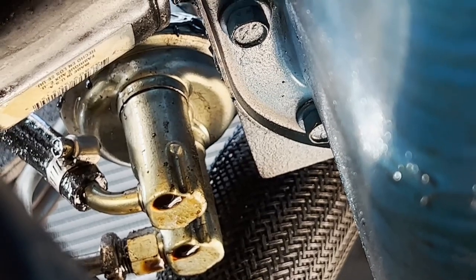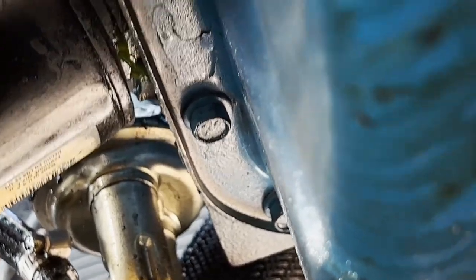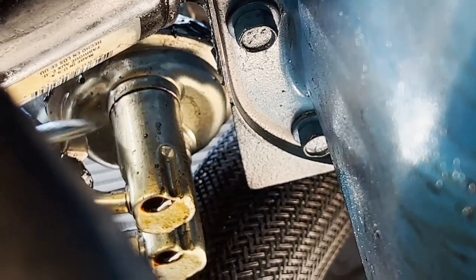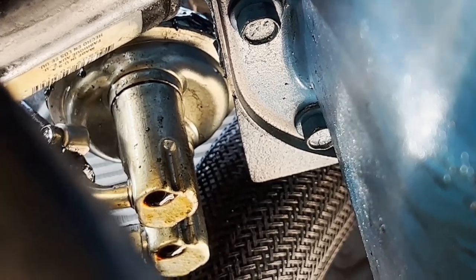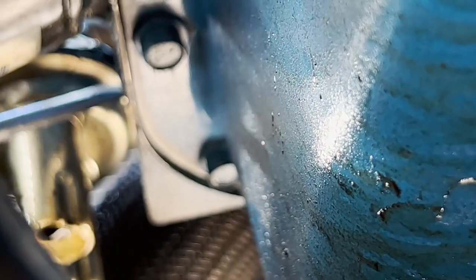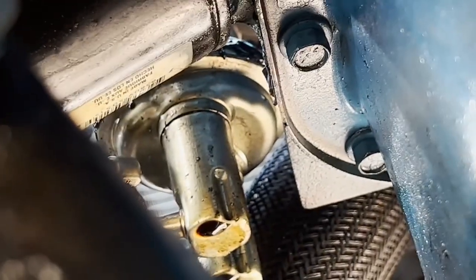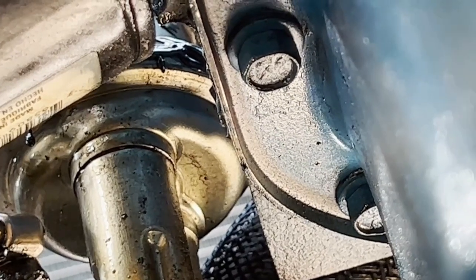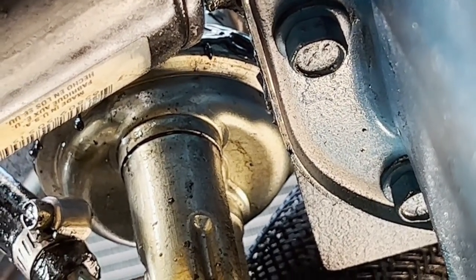Zooming in from underneath, right here and the same thing on the other side — that's the inlet — right there, and the same thing where the outlet housing is pressed into the bottom housing, it's leaking. After I wiped that off and JB welded the top, you can see it's not coming down from above anymore; it's coming out of right where that's pressed together.